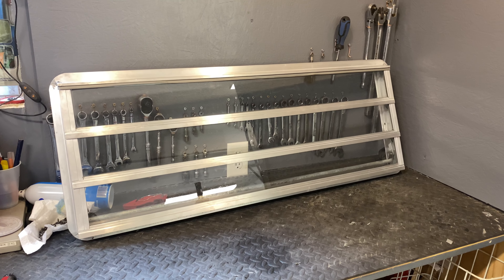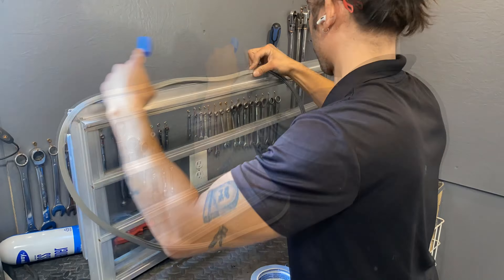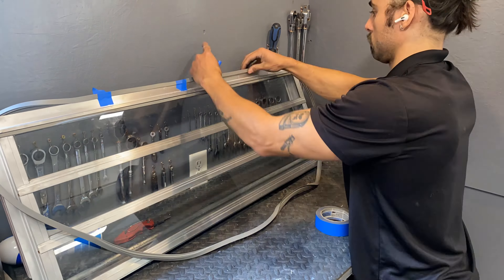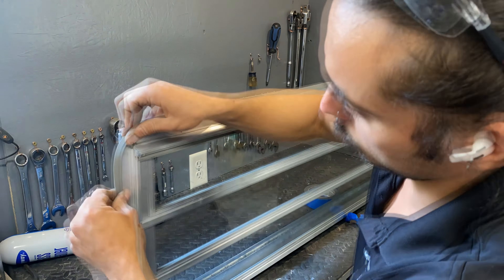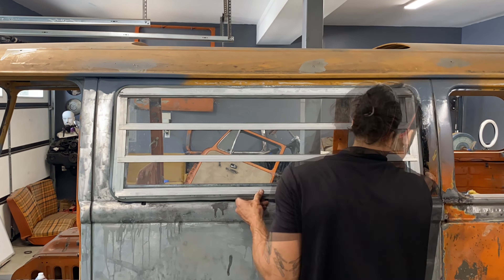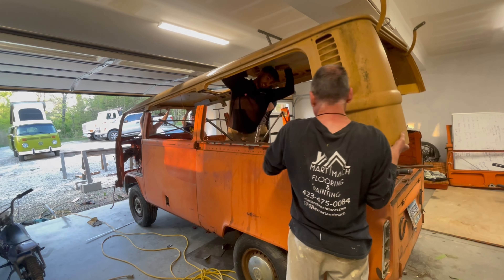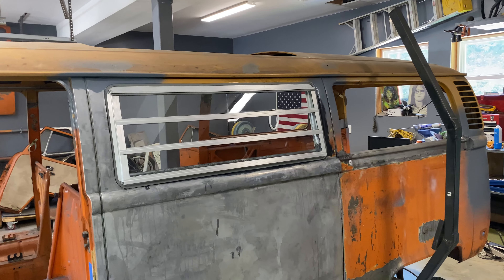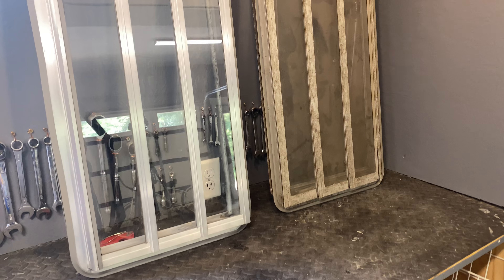But hey, look at this — it came out quite nice. It looks beautiful. Now we can install the main window seal. Unfortunately, due to the fact that this is not a pre-curved seal, it is quite difficult to install. I used a little blue tape to hold it in place, but until it's actually installed in the window opening, it won't take those curves around the edges correctly. Keep that in mind — it's quite frustrating. We can finally attempt to install it for the first time and see if everything's going to line up and fit. Keep in mind I did not only repair this window seal, but this is a completely different roof welded onto my bus, so if some measurements are incorrect, it's not going to fit. But thankfully, after a little bit of lubricating, it fit — and it looks beautiful. I'm happy with this. I hope you guys enjoyed that, but we're all out of time, so make sure you subscribe to the channel and I will see you in the next one. Bye.